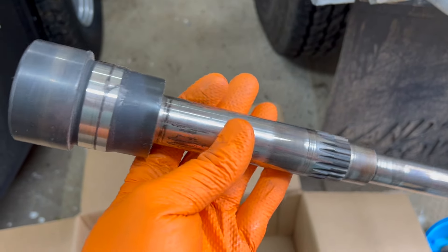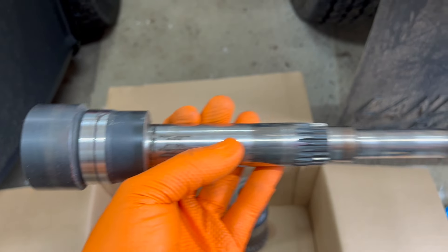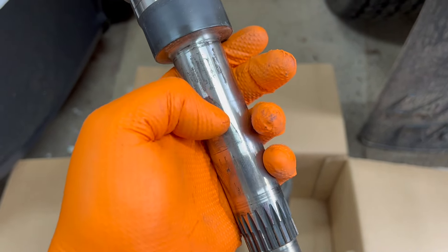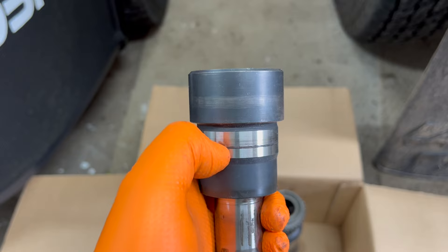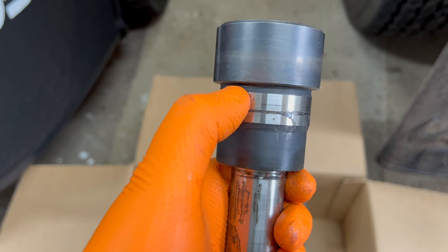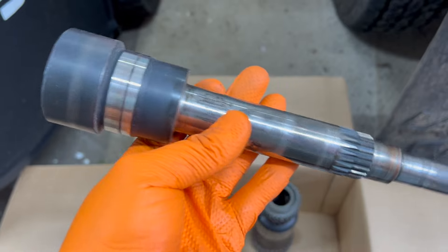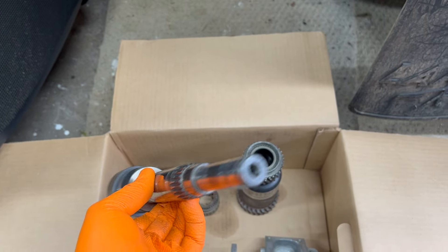And last of all, the main shaft. Up until recently these were available and I thought about buying a new one, but then they stopped being available. So I'm really hoping someone finds or produces a batch and I'll get one. This surface here is a bit knackered — if I can get that ground and hard chrome coated, I will — and maybe this surface too. Although it is marked, if you run your nail over it you can't actually feel it, which is pretty good because that's the sealing surface. I think they were about £150 when they were available, so let's have a think about that.